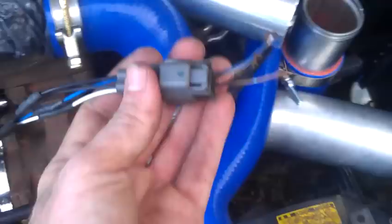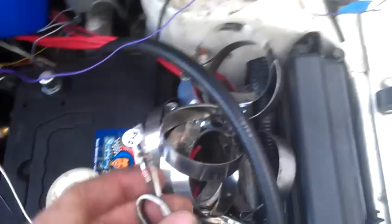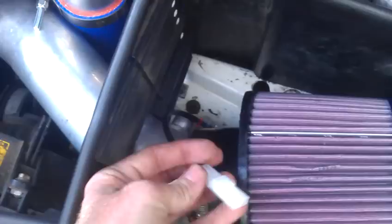This is the only sensor that's not connected — it's the air temperature and air flow sensor for the Autronic EMS. I'm going to put a little dot of solder on it, heat it up and run some solder to make sure it's a good solid connection. Then I'll just stick it right there in that little hole and seal it off somehow. I just have to pop the connectors inside of this and that's it.